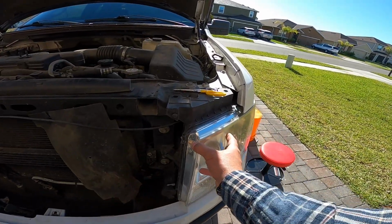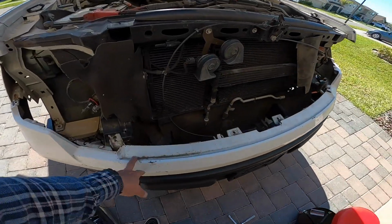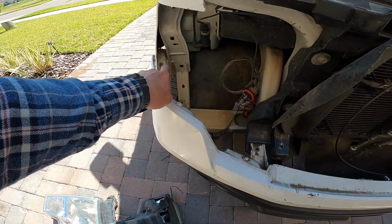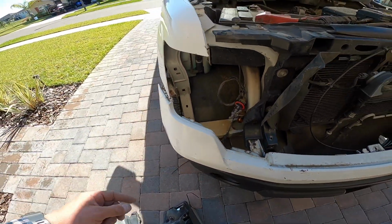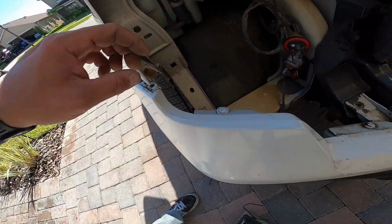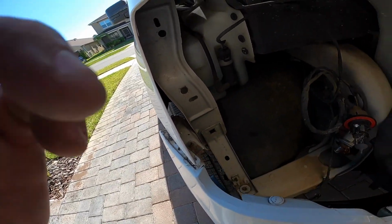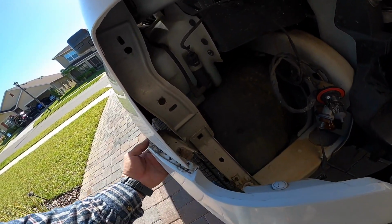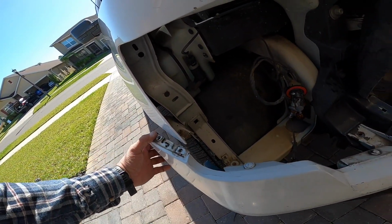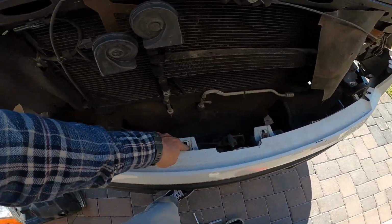All right, guys, I'm also gonna take off these lights. There's one here, one here, one here. To take this piece off, there's a screw that's here, and there's 3 screws in here. 1, 2, and then there's one back in here where my finger's at, 3. It's easier to use a short ratchet here for this one, a long extension so you can use it here for the center, and then the back one, you need a short extension and do it at an angle. It's kind of a pain in the butt. But now this piece is ready to come off after I remove these 2 screws.